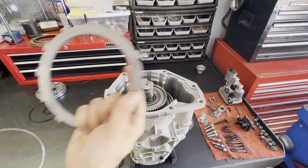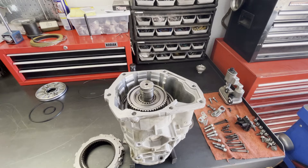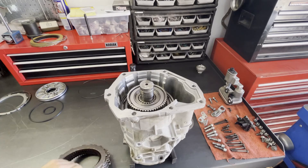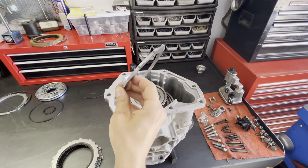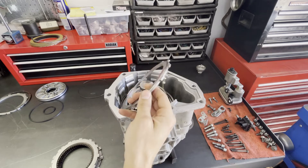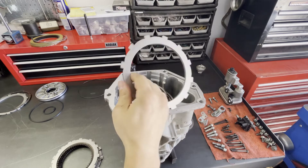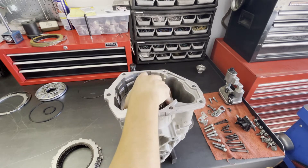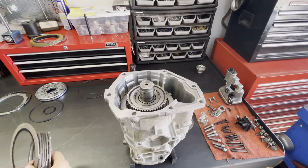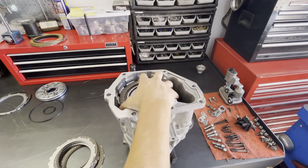The flat snap ring — the wave snap ring is going to be left out. This pressure plate, which would be standard for everything but the 48RE diesel, is also going to be left out. When you install the stepped pressure plate, you're going to install the step facing down, or rearward. This step measures approximately 85 thousandths of an inch. It goes face down, then you just go steel, clutch, steel, clutch, steel, clutch until you're all out of steel and clutches.